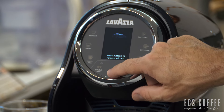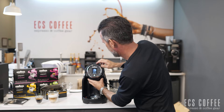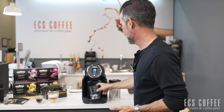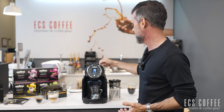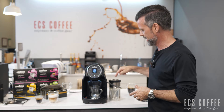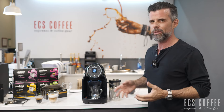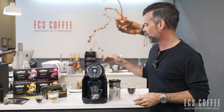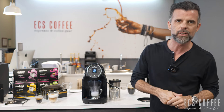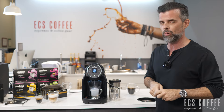Press buttons to remove, press clean milk unit, press key. So you manually clean this out — rinse it — then insert the milk unit and press any key. Place an empty glass. It's asking you to take it out, rinse it, and put cleaning solution in. Theoretically if I had cleaning solution, I'd put it in here and it sucks it through the piping system. That's kind of what they do on most of these machines. That's probably all the maintenance you'll have to do, except for dumping the pucks when they get full — and it will tell you.